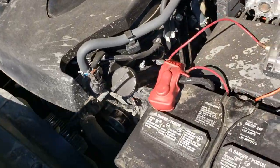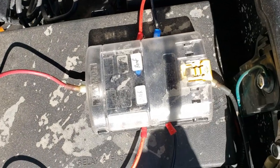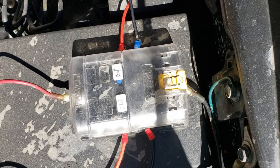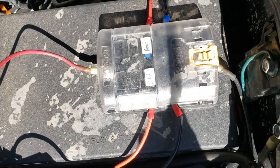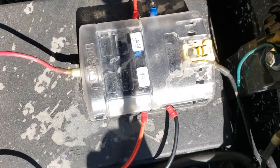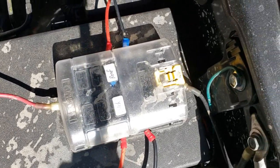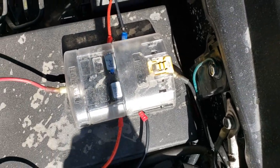Here's what I'm currently working with. I had actually gotten a fuse switch panel that has up to six spots on it. It's supposed to be waterproof — it says you can use it for marine applications and that sort of stuff. However, like the third time I went off-roading with this truck, everything shorted out and I did trace it back to this panel. So it appears that this Blue Sea fuse switch panel is not in fact waterproof. That is the reason why I'm switching out for this six-way.